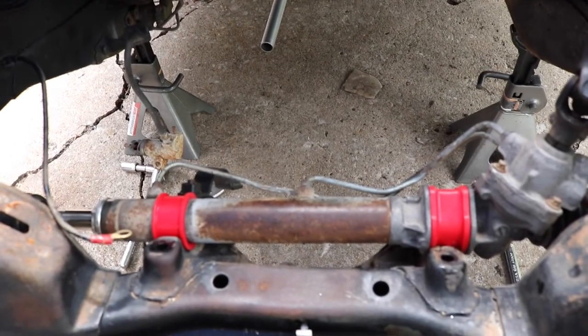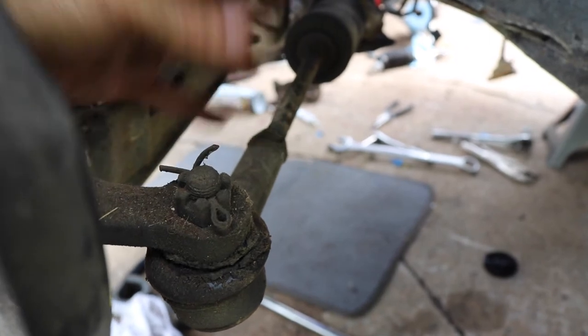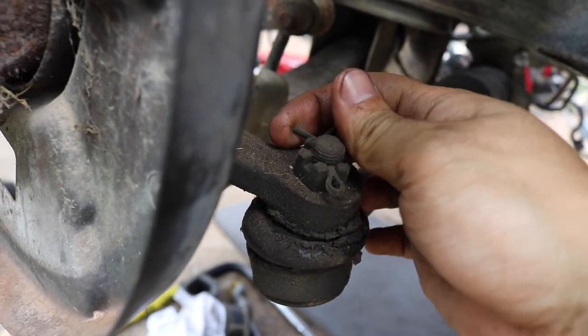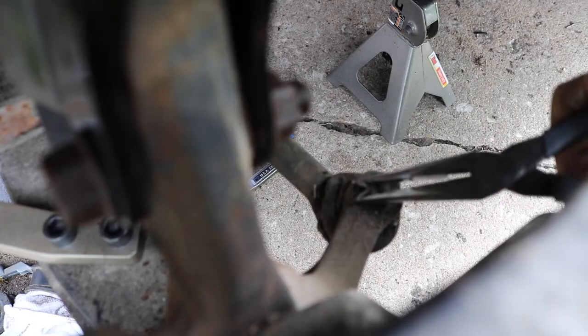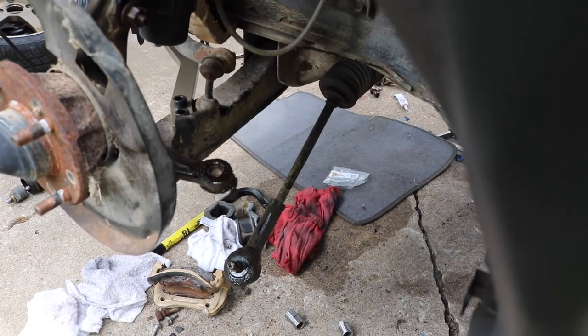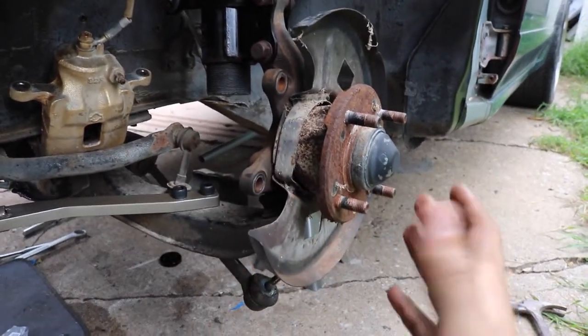Instead of dropping the front subframe to get that steering column bushing out, I'm trying my best just to mess with the steering rack to put in that new bushing. That's going to involve undoing those brackets and also taking off the stock 240 tie rods to have clearance with the steering rack. In order to take out the tie rod - the shaft that goes into the steering rack - we're going to undo the cotter pin, slide that out, undo the bolt, and it should pop right out. After a little work with some PB Blaster and a hammer, the tie rods are all set. I wanted the hubs to be as straight as possible before I took them off so they'd be straight when I put them back on.